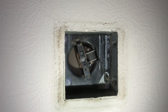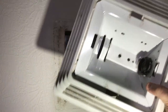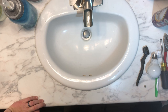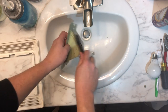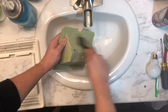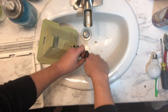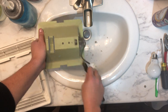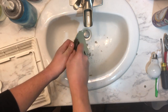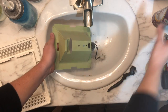It sounds a whole lot better — so we solved that problem. We still need to go ahead and finish cleaning up the rest of the bracket; it looks pretty good but still has some work to do. This is pretty much the same concept we were just doing. You do not want to get water on the actual device here, so do not turn on the water, but you can go ahead and really just start scraping it — just getting all that dust out. This will just help prevent it from reclogging as quickly. You technically could just put all this back up, but then you're putting all this stuff right back up to where you already had the problem.